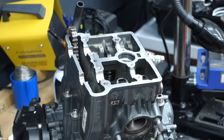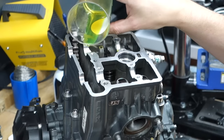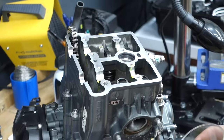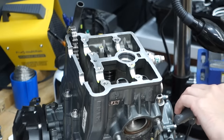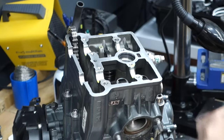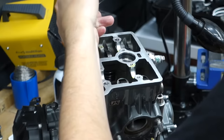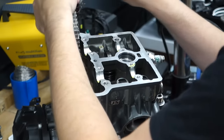From here we're going to oil the cams and pivot points. We want to drop a little bit of oil on there - it's way too much but whatever. We start with - wait, let's make sure we're still at top dead center; that's kind of important. I always pick the wrong Allen key. We're not at top dead center - glad I checked. There we go, that is now set.